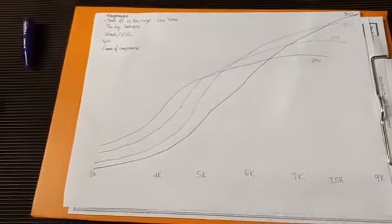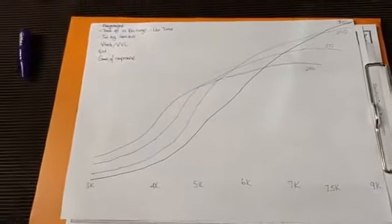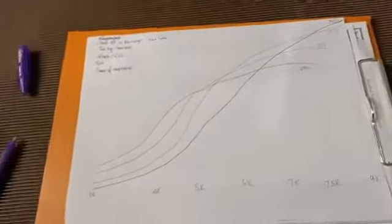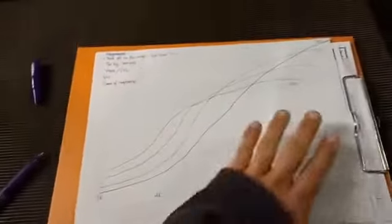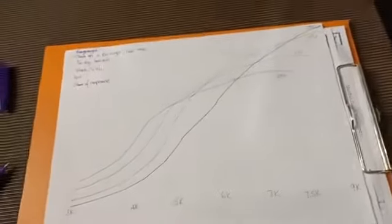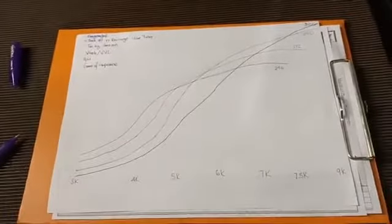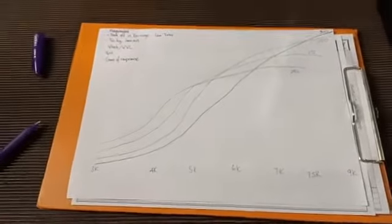So this is a little bit like going from a smaller turbo to a bigger turbo. We've got more top end, but we've given away bottom end. So cams are a game of compromise and trade-off. As we go bigger and smaller, we gain in one area while we give away from the other. So when picking one, the goal is to choose one that suits where you want your power delivery to be, because this is going to be different for each person.